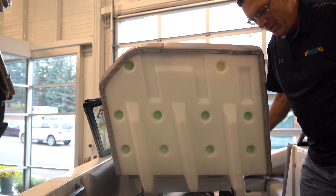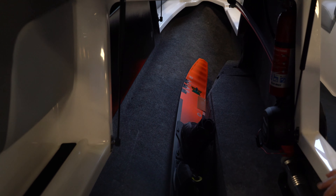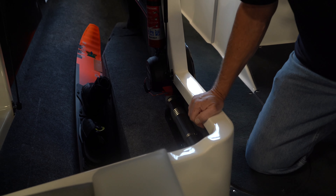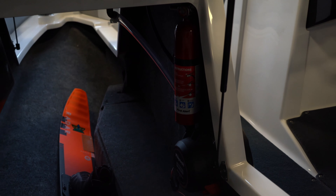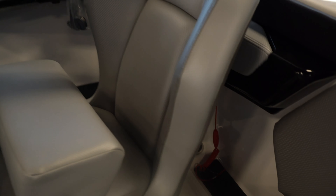For your glove compartment — little things that Mastercraft does — there's a hose in here. If you get any water in that glove box, it drains out on its own. They also have a mount for your ski pylon, which pops in the rear of the boat very easily. And of course, that's your fire extinguisher, which is secondary to the Halon fire extinguishing system. If it gets 450 degrees in the engine compartment, it releases the Halon gases and puts the fire out — God forbid that happens.